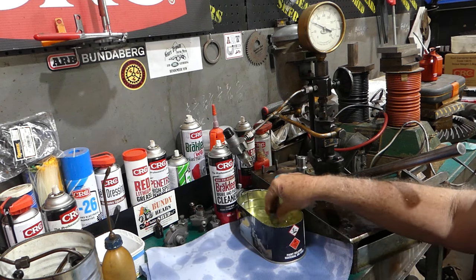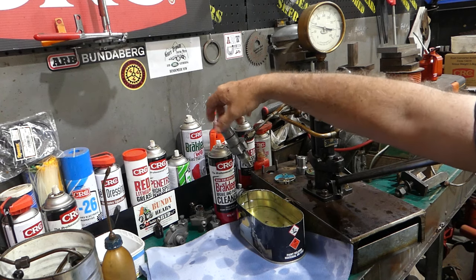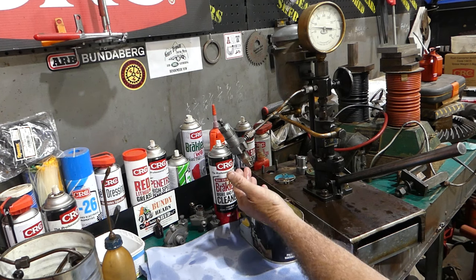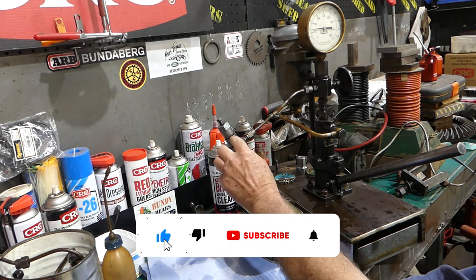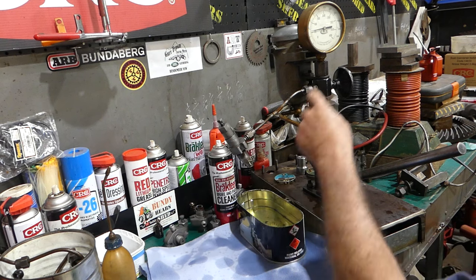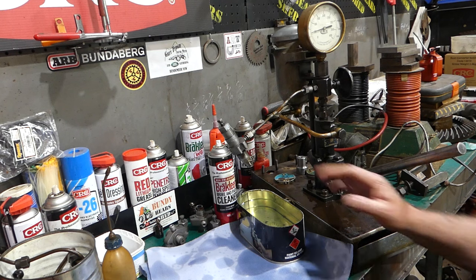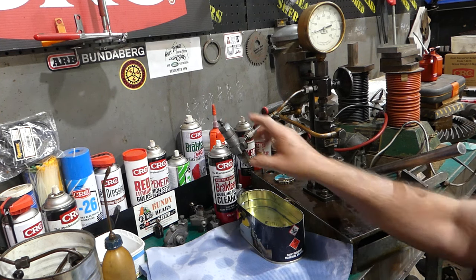I'll put this cap back on — it needs a copper washer in there yet. I'm waiting on my mate Tony who is a member of the club — he's going to find the exact pressure spec. So now we haven't got a leaky injector nozzle and you can hear it cracking off. All we have to do now is set the pressure, put a copper washer in there, and nip that right down hard so it doesn't leak, then check the pressure again. I rang Tony but haven't got a message back yet — he's obviously busy. That nozzle is good and I'm going to slowly work through the others.